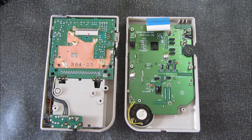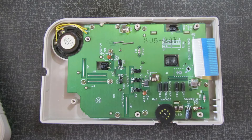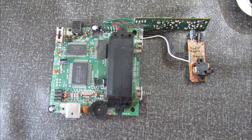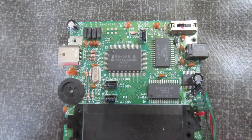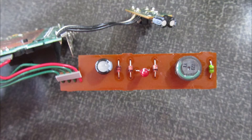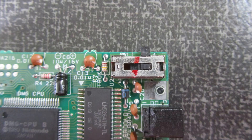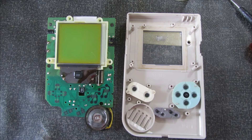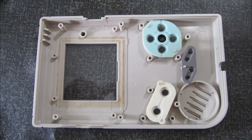Looking at the equipment opened here, friends, it's quite simple. The Game Boy has two boards and the main board is quite large. The components are simple — the capacitors are very small but easy to replace. We can see it was well preserved with no sign of oxidation. But the on/off switch is not great, and the speaker is not working. So we'll take a close look at that board, as it sometimes cuts the speaker sound.